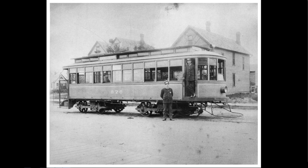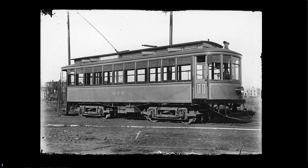About 1900, they had built a couple of batches of new cars and said they needed a few smaller ones for lighter lines. So this is what they called the C-Class — they built about 30 of these at about 35 feet instead of 40 feet long, put out on the lighter lines. This one was built with a two-motor Bemis truck, and here's one a few years later with a Brill truck, a much better commercial truck with twice as much power.